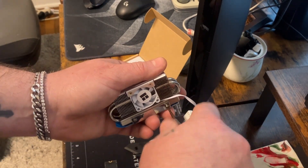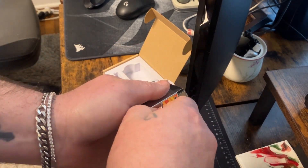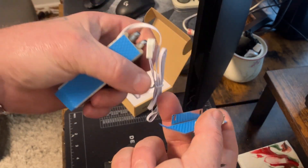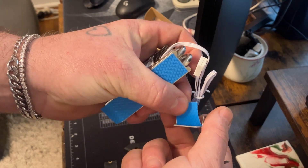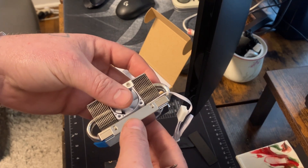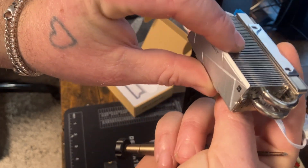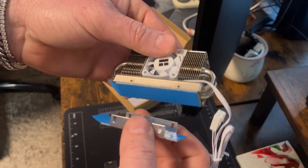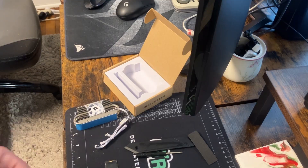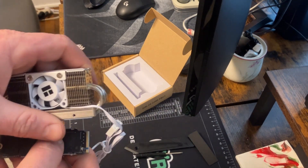Once you get these four screws out, you'll see it has thermal pads already attached to both sides with a little piece of tape covering them. I'm going to put my drive in with the tape still on just to eyeball placement — you could put it too far forward or too far back. I discovered that my back mounting hole lined up perfectly in between the two heat pipes.